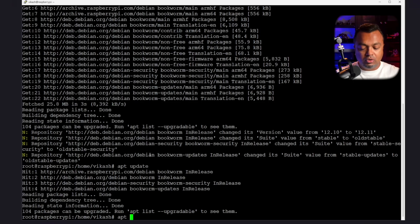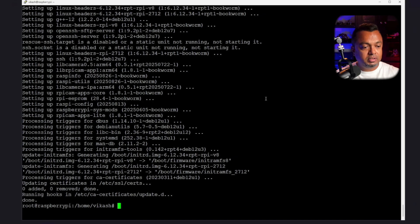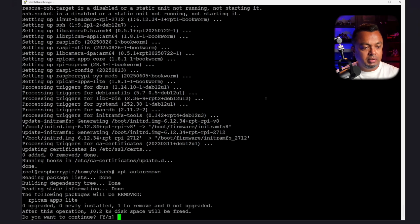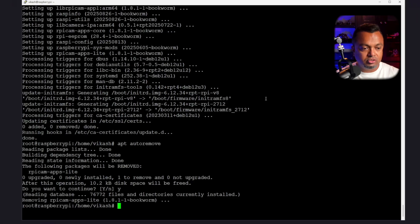The next step is to run the upgrade. This will upgrade the operating system and packages, but also the configuration utilities used to set up the EEPROM settings on the Raspberry Pi — so the firmware gets updated too. We confirm and wait for the upgrade to finish. Then we do some cleanup with apt autoremove, to make sure packages that are no longer needed are deleted from storage. I want a clean starting operating system because this will be the base for my NVMe boot.